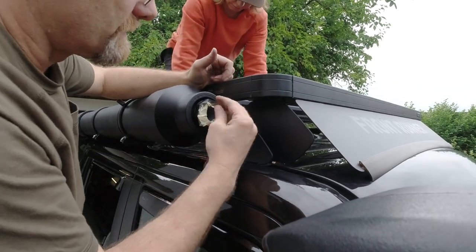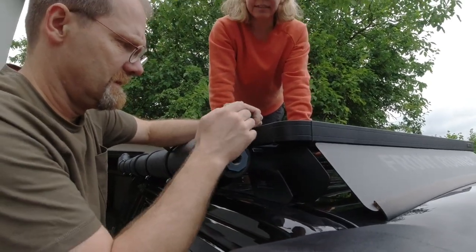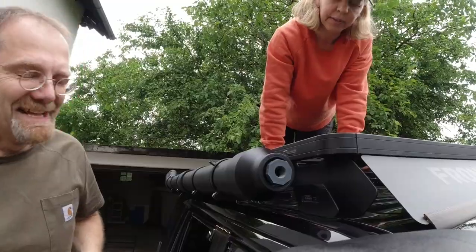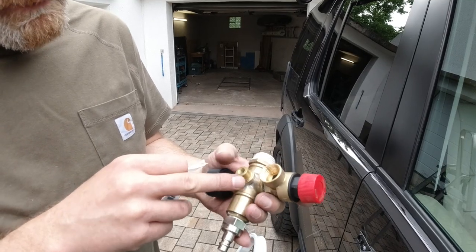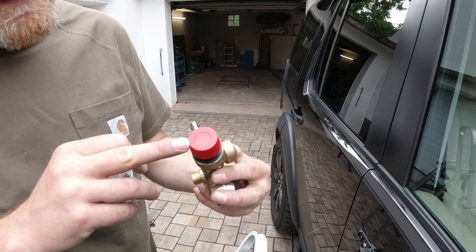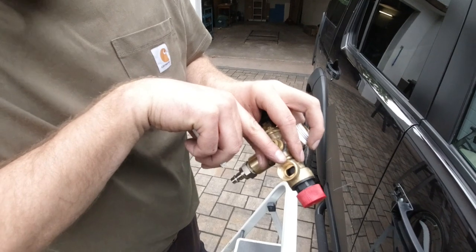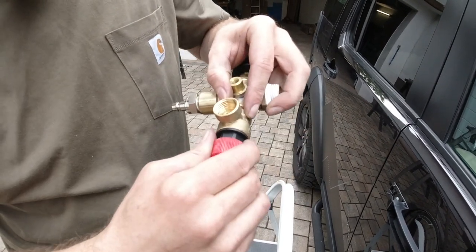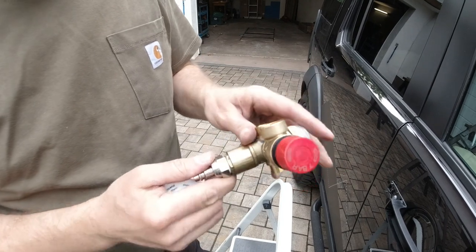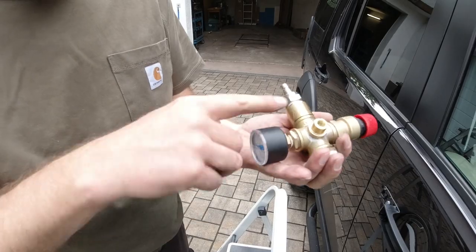Maybe I got a little excited doing this, so I over-engineered it. A nice Festo gauge, a couple of reducers, and this is an overpressure valve set to 7 bar. It's got a spring inside, and when the water pressure pushes here, it would push this cap out and the water would jump out here. And then I soldered on 2 posts in order to put a cover on.